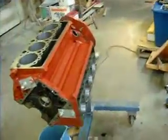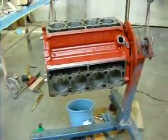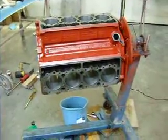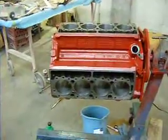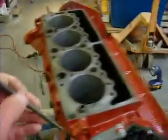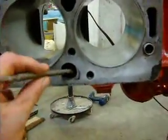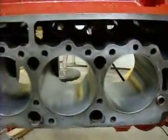Obviously I'm not hot tanking the block. Even so, that doesn't always remove it — you'd actually have to pickle the tank. So if you were still hot tanking it, this might not be a bad idea to try something like this as well, to save you some money if you're willing to spend a little bit of time. So I took just a round file sort of thing, or use an ice pick or whatever, and just worked my way through most of the cooling passages. I scraped any of the big chunks away first and then just blew it out with some compressed air.